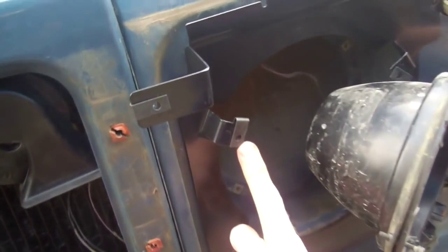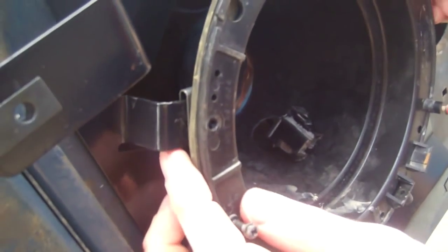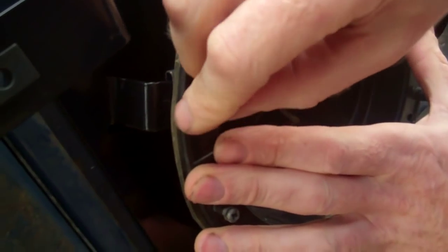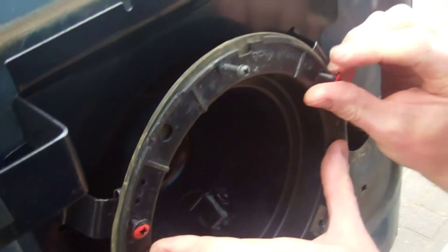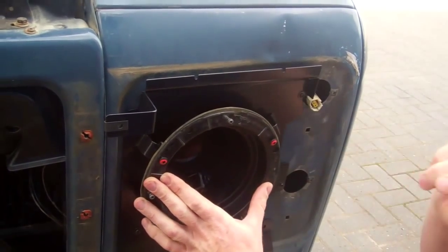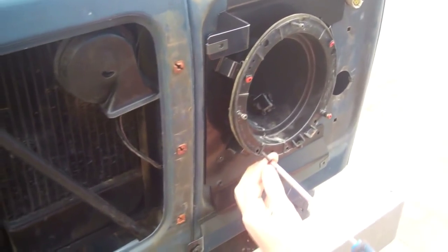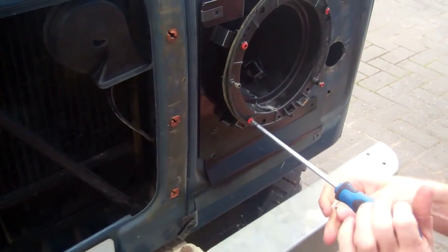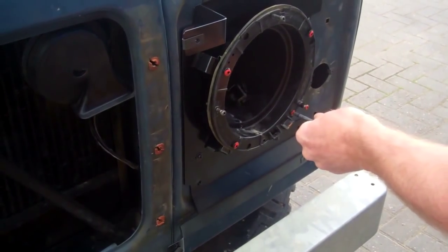Okay, so now we've pre-assembled these clips onto these protruding legs here. In the kit, they come in a separate bag, so Tom's assembled them for me. And then I'm going to put back in the four screws that we took out originally. And again, your screws might be a little rusty. Did you replace these, Tom? Yes, I did. Are there a few spare self-tappers in the kit, Tom? Not that size, no. So you may want to raid your self-tapper pot, depending how yours are. This car's had a pretty hard life, hasn't it? So chances are yours will be better rather than worse.